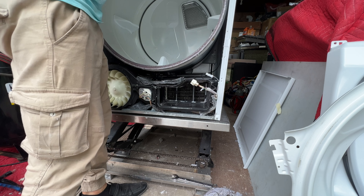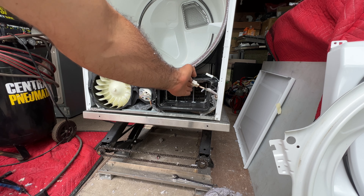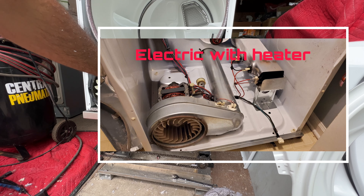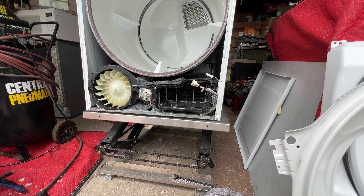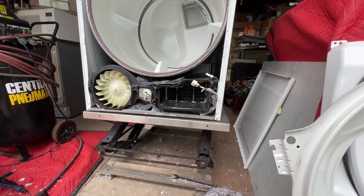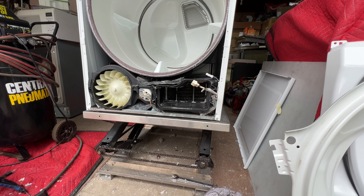I will be working on the hard part now. On electrical dryers you've got the heating element located right there with only that much space. But on this heat pump dryer because you've got the condenser coils, evaporator coils, and hoses, you do not have enough space to stick both hands in. You've got two options: if you've got a tiny hand you can stick it in from this area while lifting the drum up a little bit, or you can install the belt on top of the pulley using one hand. I have experience installing belts with one hand but this is my first time trying it on this model.